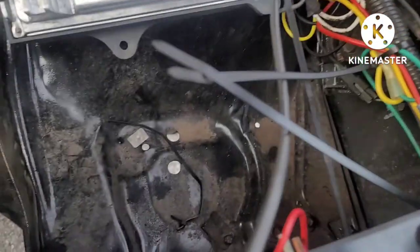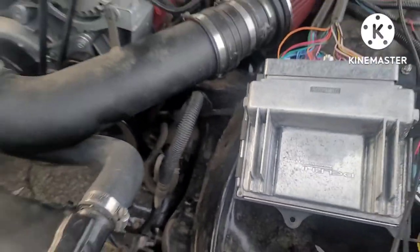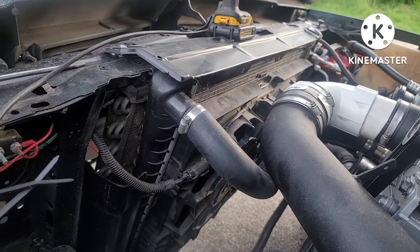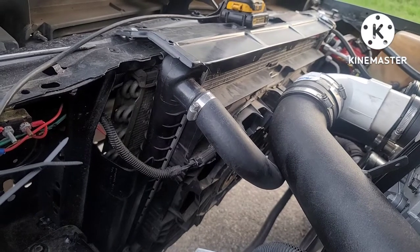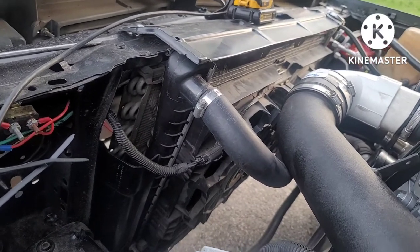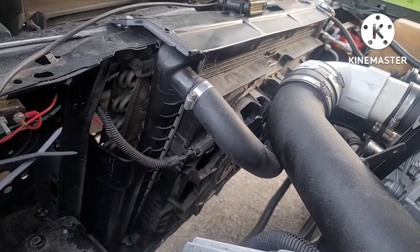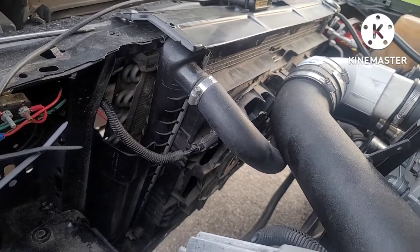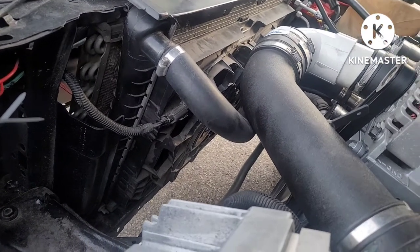If it keeps the car cool — I think he could have got a bigger radiator and it would keep the car a whole lot cooler. That looks like a little V6 radiator. But it keeps it under 210, about 205–207, even in the heat. With those fans it keeps it cool, but a bigger radiator would keep it even cooler. In my station wagon my stuff stays at 185–190 because I bought the biggest radiator that could fit inside the radiator housing.